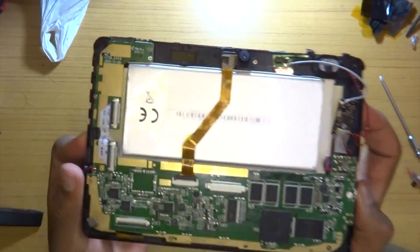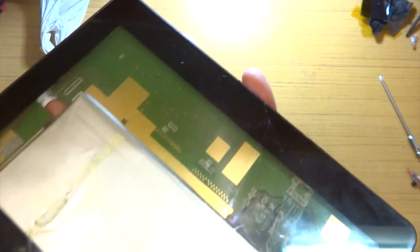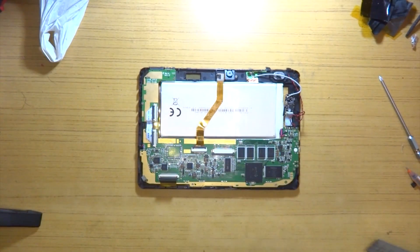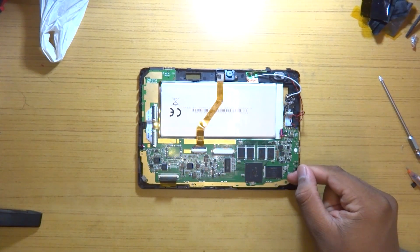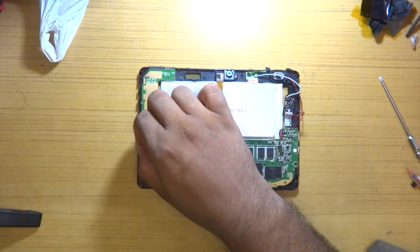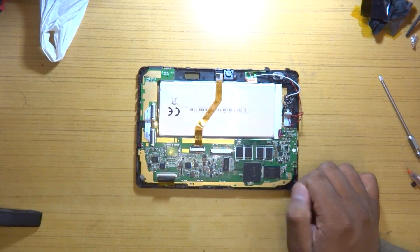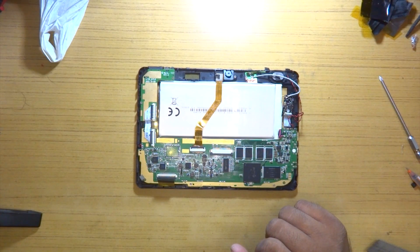This is how it looks - pretty neat, and from the other side it looks pretty cool as well - definitely a development board kind of vibe. What I'm going to do now is check the TX and RX voltages and then solder what I need for TX and RX. I'm going to pause the recording now - I've recorded for around 27 minutes - and get back when I'm done with the soldering.